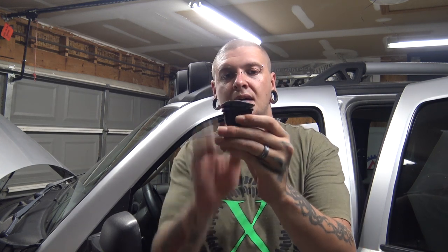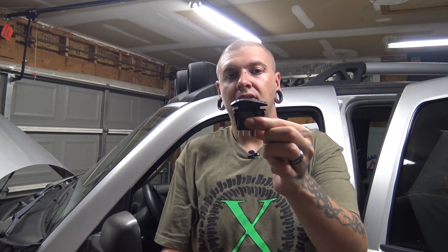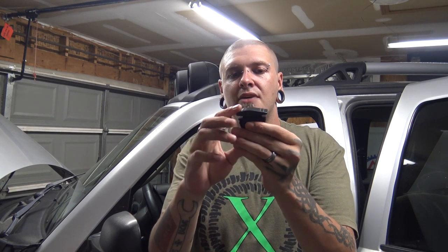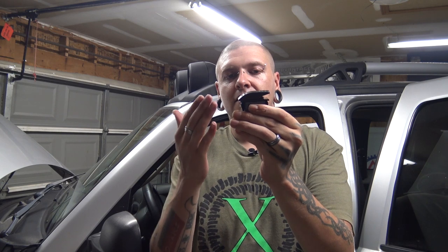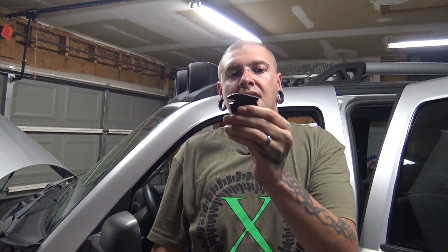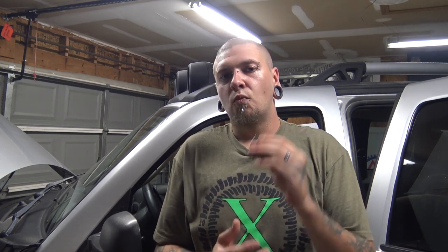The way we're going to wire this switch up is: if the switch is in the middle, you put your vehicle in reverse and your factory reverse lights come on, but the auxiliary lights we're installing will not come on. If you flip it one direction, the lights will come on by themselves — you don't have to have the vehicle in reverse. If you flip it the other direction, it'll be the auto function, so as soon as you put the vehicle in reverse they'll automatically come on with your reverse lights. We have to run just a little bit of wiring and one relay, so it's not too complicated.